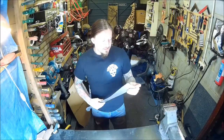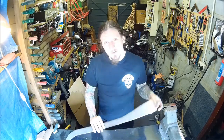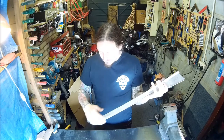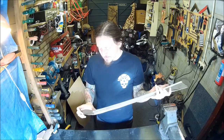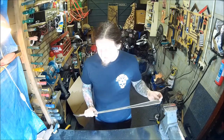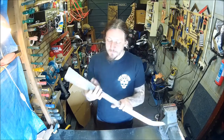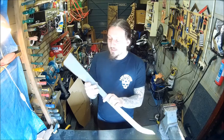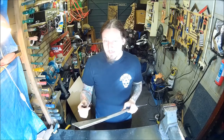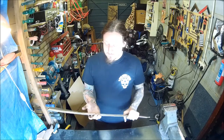Right, so this is where we are after some cutting and grinding. I still need to finesse and dress this down to make it exactly what I want, because I've got my lines drawn on the other side. I need to go over it with some flap discs to make it right — cutting 3mm is actually quite a long process and it's messy; metal shavings are everywhere. Let's focus on getting it to the right shape, then we need to bend it at the right spot, weld that bend so it's strong and proper. Fingers crossed I've got a good thing going here.